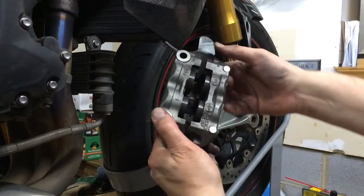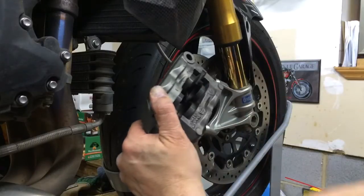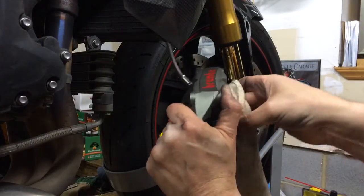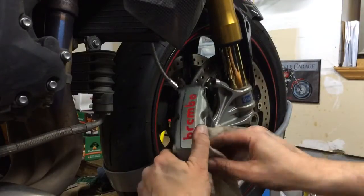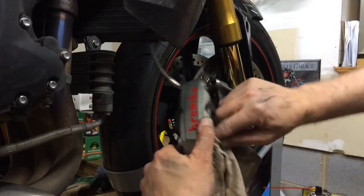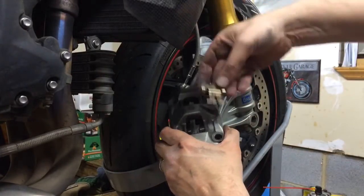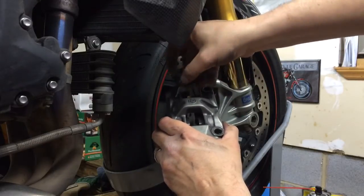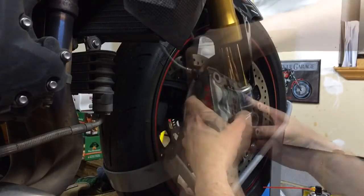I don't know if you can tell in the video, but before you could see a line where there was dirt. Now it looks pretty good. And this contact cleaner evaporates extremely fast. Okay, so now we want to put the pads back in. Remember, look for that arrow. So we want to put the pads back in because we need to separate these pistons.